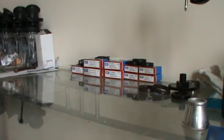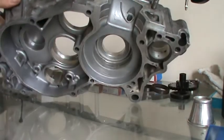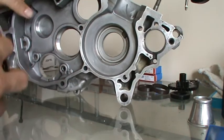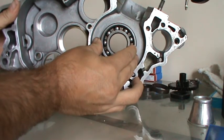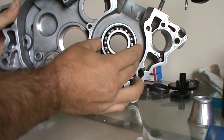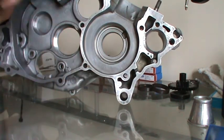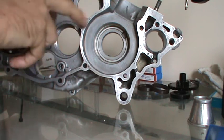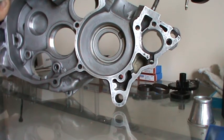A lot of people have asked about the size of the bearings, and is it really important? The best way to get the bearings out of here — and it's not by getting them pressed in either. You do not press them in, you do not try and press them back out. It actually causes more problems, because being an aluminium cast head or lower crankcase in this case, you'll find that you could end up damaging all of this. So the question is, how do you get it in and get it out?